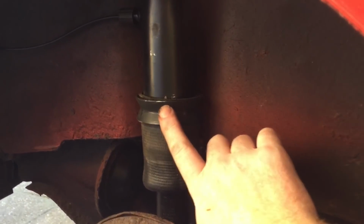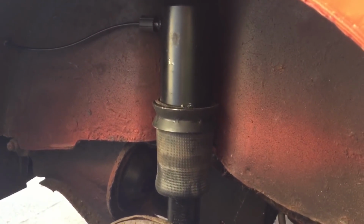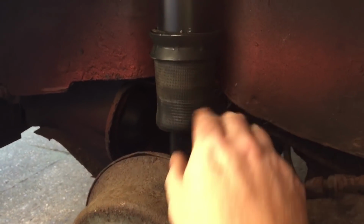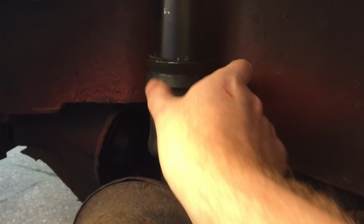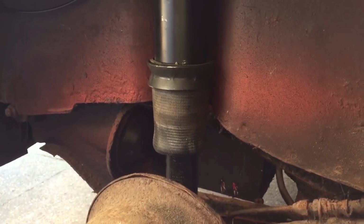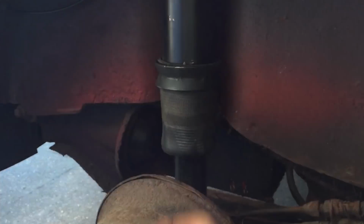And yeah, so the only problem in the area is this: it's very close to the wheelbase, so I'll pop some spacers on just for now, or I'm going to have to get some slightly bigger spacers just to clear that, give it a bit of clearance. It's not far off, but it touches. The other option, I'm not too sure how all things work, is to replace this. This is obviously just Chinese cheapness. It's just pressed round to clamp that. I wonder if I can get a marine type, army type, I don't know what it is, something not a very big strong Jubilee clip. That will give me back another 5mm easy, no problems, from that side and this side.